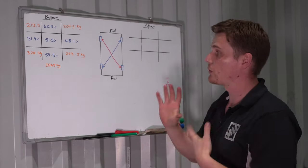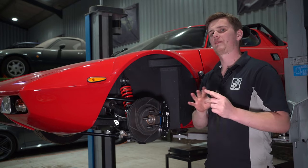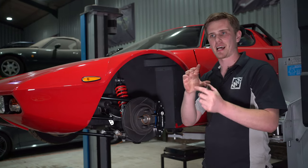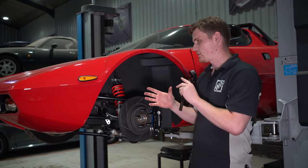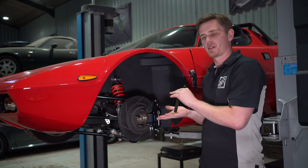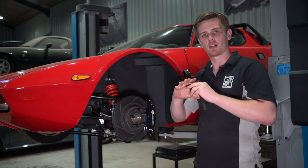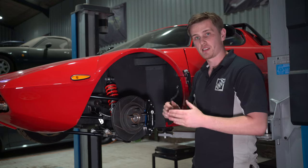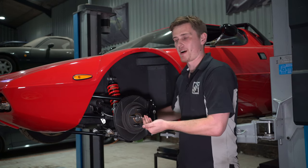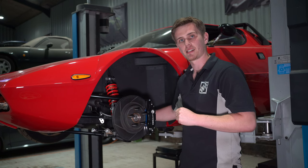We've got the front-left wheel off the car to make some ride height changes. We'll have another episode with more detail on how to choose which corners to adjust, but for now we're covering the fundamentals. We're going to increase ride height on the front-left, but not put the full change on one corner - we'll divide that change around all four corners so no single corner has too large a ride height difference. You just need a C-spanner on the C-collars of the coil over: turn it one way to raise ride height, the other way to lower it - and that pitches mass around the car.